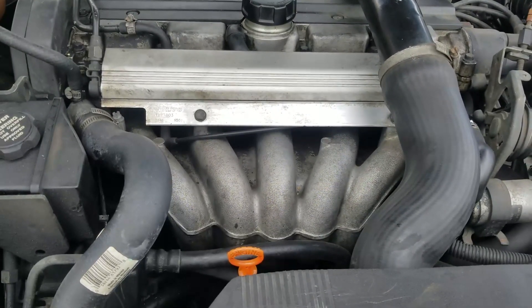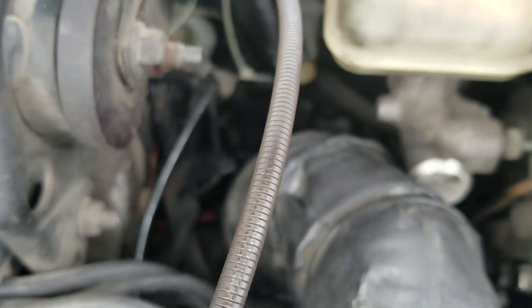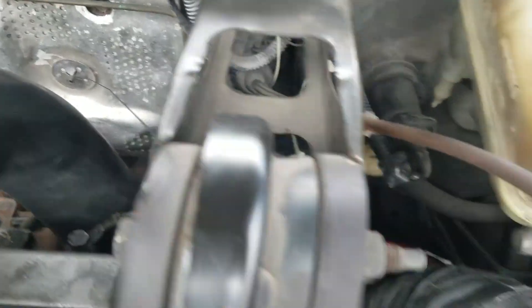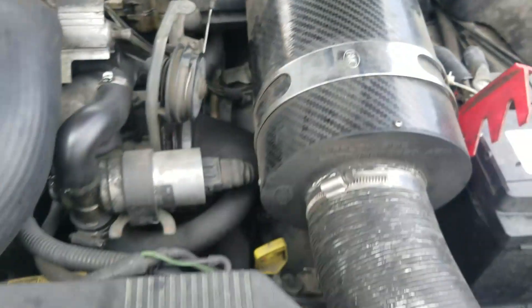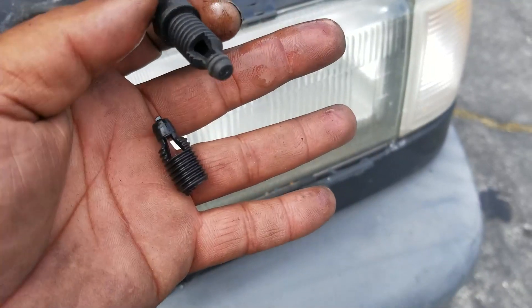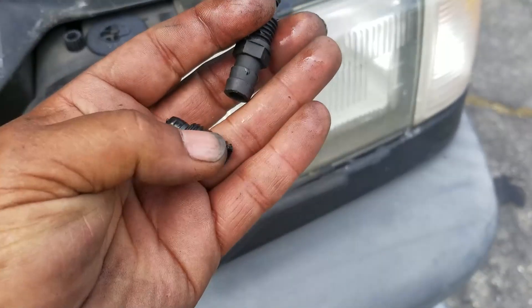Make sure you get the Volvo parts for that. Next we're going to drop the coolant and replace the coolant supply hose on the bottom of the turbo — the one that bolts in the back of the turbo. Then we'll see what's next. The original drain cock was broken; I had one in my spare parts so we're going to replace that.